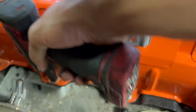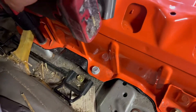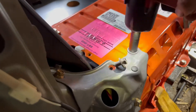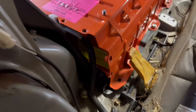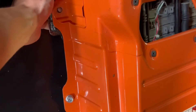Now we're going to finish taking off the 12 millimeter bolts that hold the battery down. Don't forget the same bracket on the other side with 12 millimeter bolts as well. Make sure you get these two straps off with a 10 millimeter.